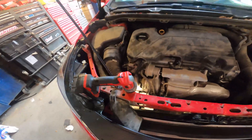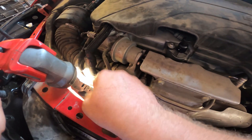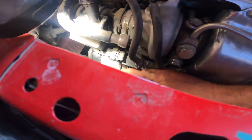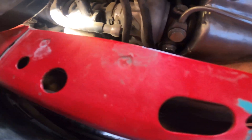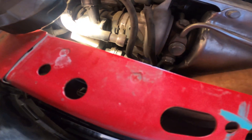You want to start on the top side typically. So apparently this little PCV valve right here — this little plastic hose is a one-time install. I don't know how accurate that is, but I don't know how to take it off so I'm working around it. Down here it comes with this end piece with the seal. What we're gonna do is get this little clip off — you can literally just push these tabs with your fingers and as long as you get it the right way you should be able to get it all the way out and unseated. I'm gonna use both hands, spread it, and get it off — then the pipe will just slide off. Once you wiggle that clip off it'll literally just press off. I used a little pick stick and just pushed it off that end.